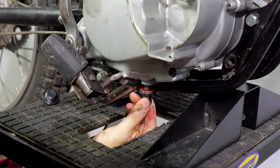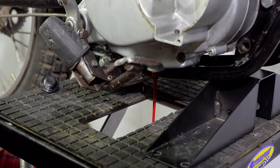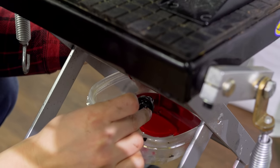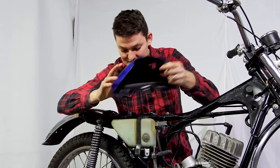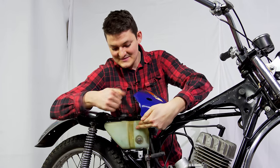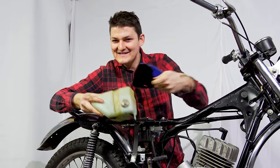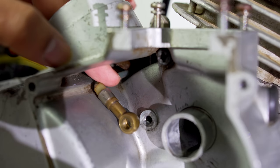Combustion is violent for the engine too, so we call this a wet sump — basically, your gears relax in a perma-bath of hot oil. Like Arnold. Some bikes have dry sumps, meaning there's a miserly old oil tank. It squirts just a bit of lubricant wherever needed and takes it back again.